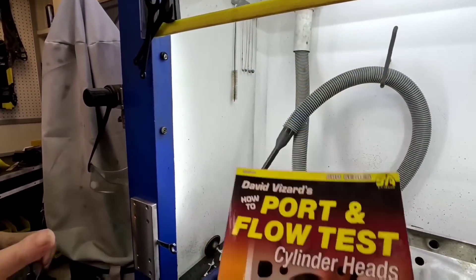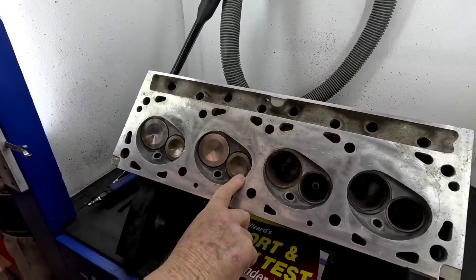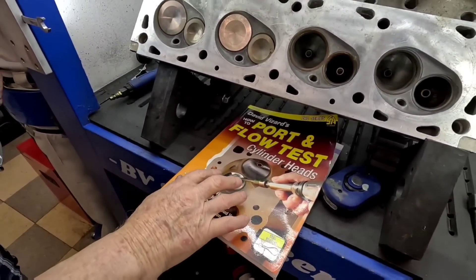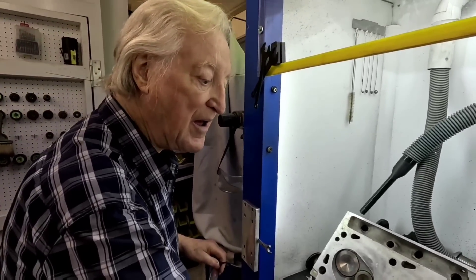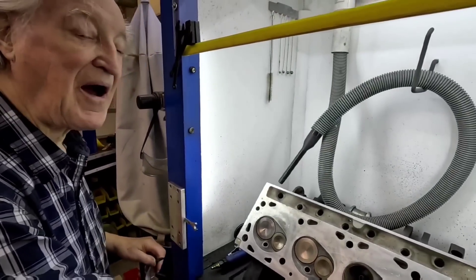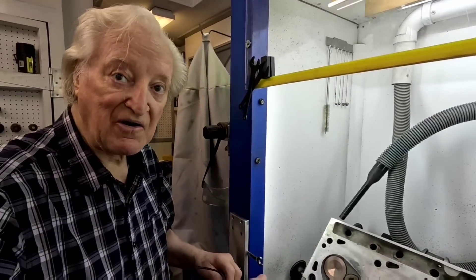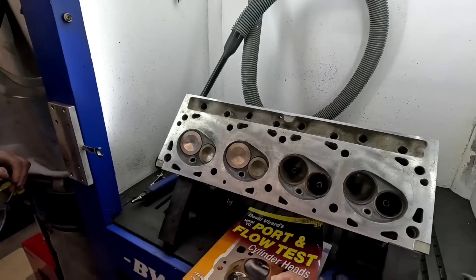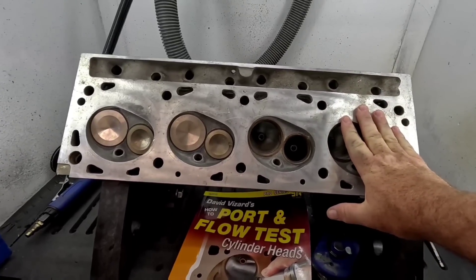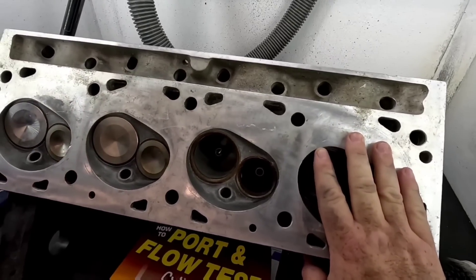What we've got here is something that has a big valve shrouding problem, and this explains how valve shrouding can destroy flow even if you do all the port work right — it's a restriction that has to be removed. David is going to show the ball method, and all the figures are in the book. Really good stuff. I'm looking forward to doing this — it's going to be quite different from the normal Unity Motorsports Garage videos, but hopefully you will get something from it.